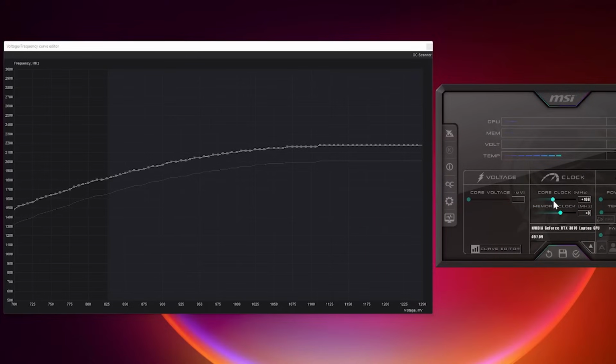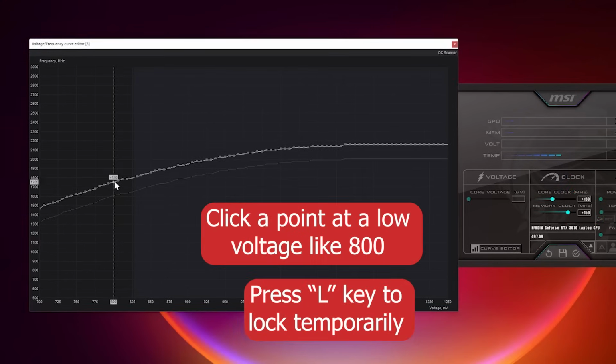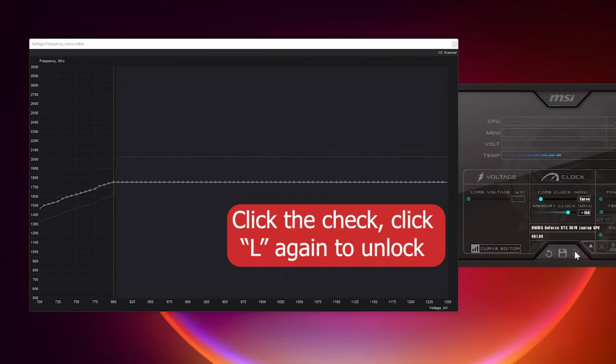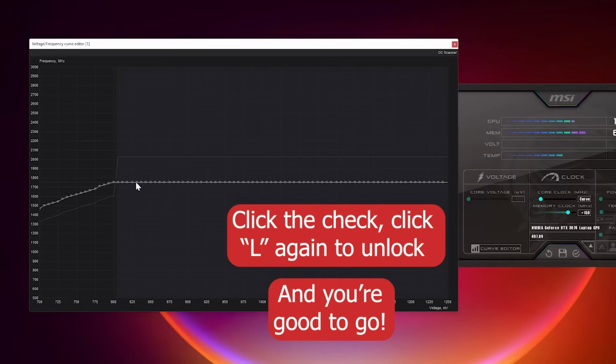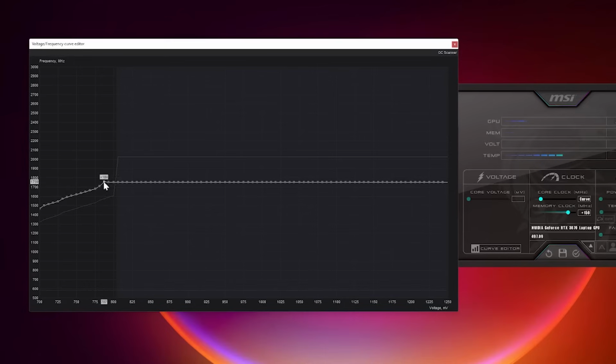All you have to do is go into MSI Afterburner and check unlock voltage curve in the settings, and I'm going to put a link in the description for exactly how to undervolt and how I did it. It works best when you combine a bit of an overclock with an undervolt. That way you're able to overclock your GPU and get more performance without all those high temperatures from it.